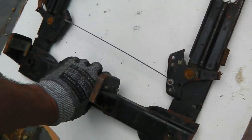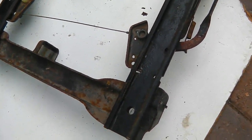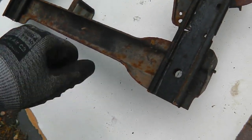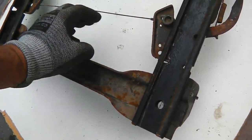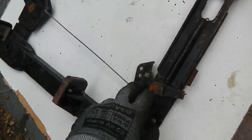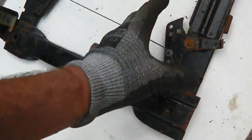You've normally got your adjuster lever on the actual, there's some rails that slot inside here. They're off, we can't powder coat those because it damages them. There's a lever on those rails which takes the seat to the front. We're going to leave the lever, but we use the base here, because that's got no ball bearings or anything to get damaged, no plastic parts. We strip it down, and this gives you an extra amount of forward.